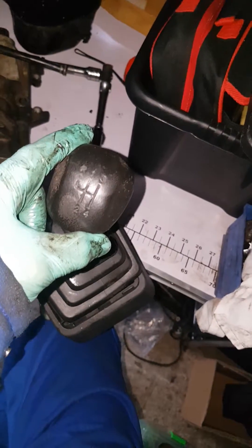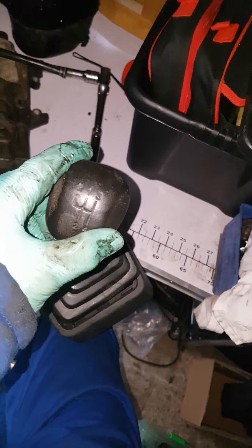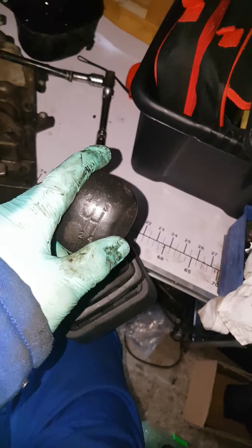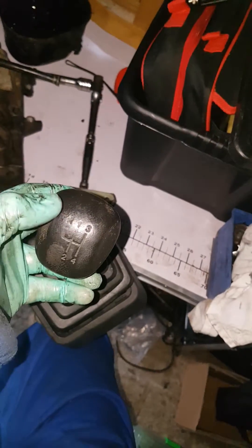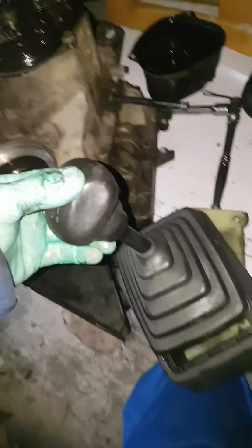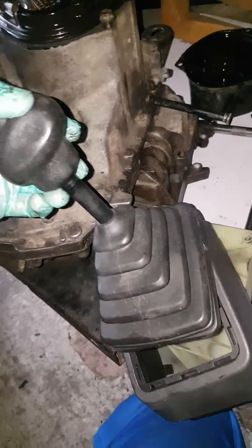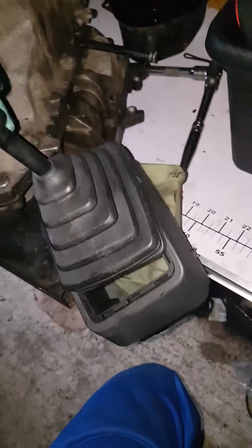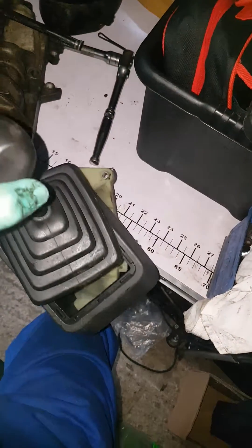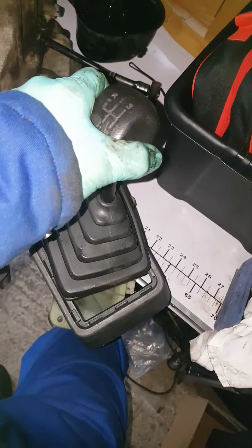This is the gear lever — I'm going to show you the typical action used to select your gears, and then I'll move on to the gearbox and show you where it translates onto it. We've got first, second, third, fourth, and then we've got reverse here. To select reverse, use this little collar here and lift it, which then allows you to move it. The collar only operates inside there to stop you accidentally selecting reverse instead of first. So we go forward and left for first.